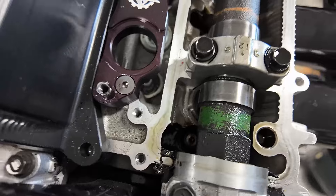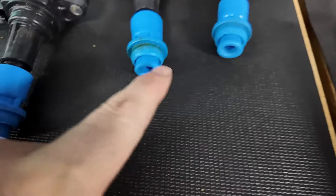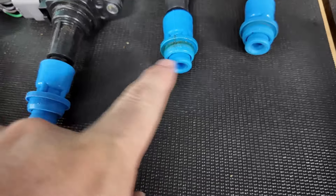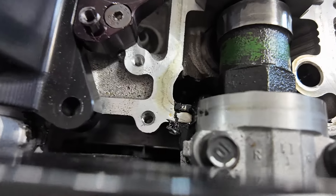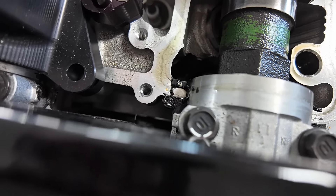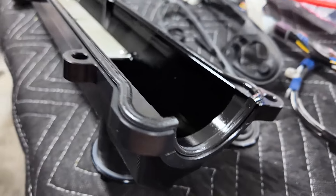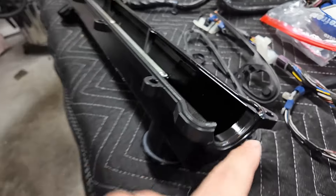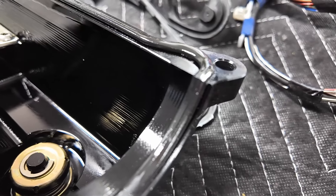The more and more I look at it - there's oil down here. I can see it on the coil packs too. It looks like when I put those on maybe I didn't tighten them up enough. You can see this back one - the oil when it runs back it pulls more towards this side. It's definitely leaking; the other ones have nothing. So it was coming from this corner here - you can see the FIPG. I have to scrape that and re-seal it better. I think that corner is what was causing me the issues.